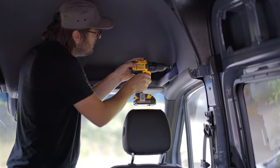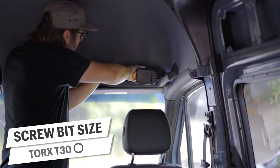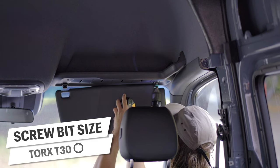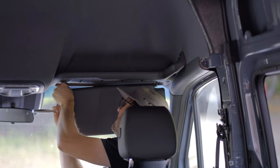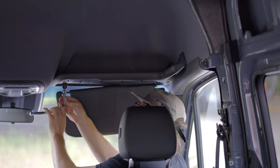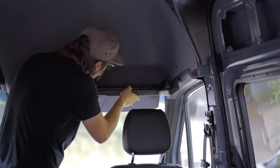The sun visors are held in place by four bolts and they are all removed with a T30 torx bit. The two on the sides come out fairly easy, but the vertical ones underneath have loctite, so they take a bit to break free. In fact, halfway through I switched to a socket to better feel this — I find I have more control with that setup compared to the drill.